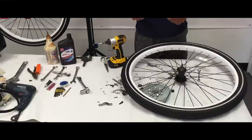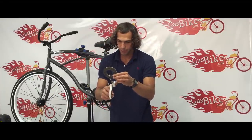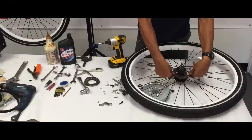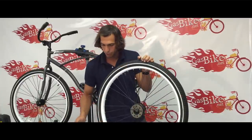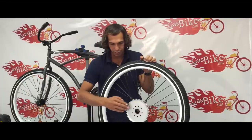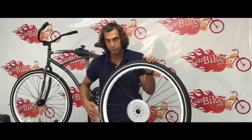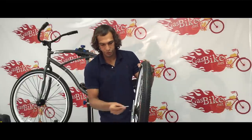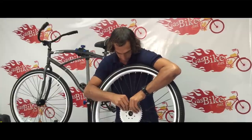So you're going to cut the thicker one to make it fit on the inside. Take your scissors, and right between two of the holes, make a cut. Remember, the thicker one goes in the middle. Now use the thinner rubber piece on the outside, and then take your sprocket. The sprocket is a little bit towards one side — I like to make it wider, so I put it on this way. This way, your chain has more clearance to not hit your wheel. If you were to flip it, it would be a little closer to the tire, so it's different for every bike. So now you get these screws, put them through the sprocket, through the rubber, through the spoke, and then through the second piece of rubber in the middle.